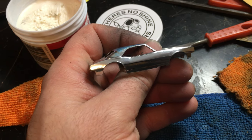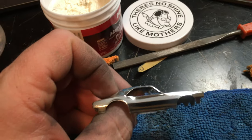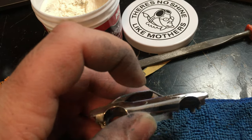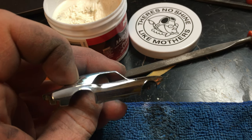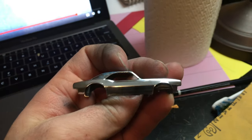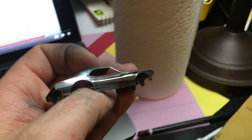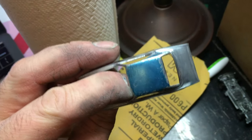I took some water and 600-grit sandpaper in little pieces at a time, and first I filed down all the casting marks on the edges. This car is being half-rebuilt anyway with the cowl, so I figured I'd make her look real good. As a comparison, you can see the rough side versus the filed-down side — it's going to be a real beauty when it's done. You've got to be careful not to go through the plating on top, so we'll keep working at this carefully.